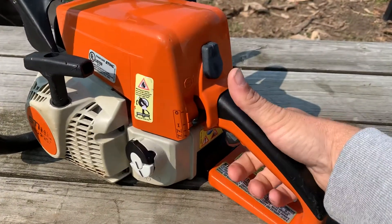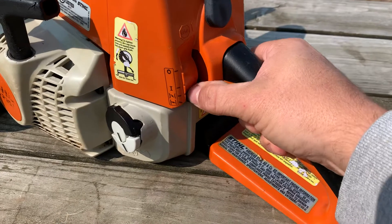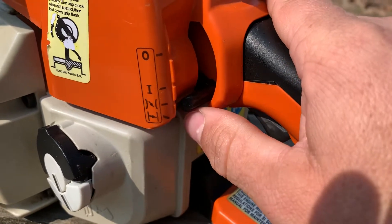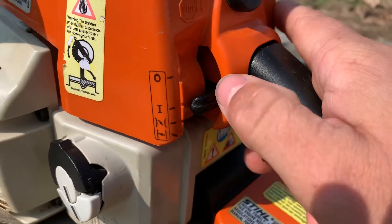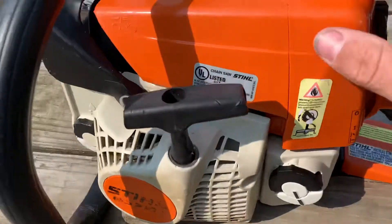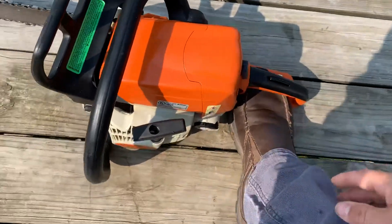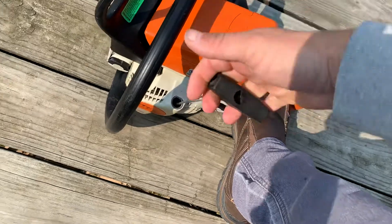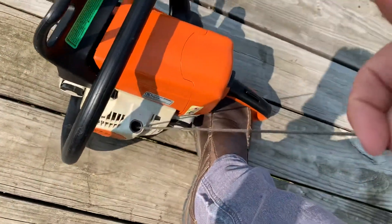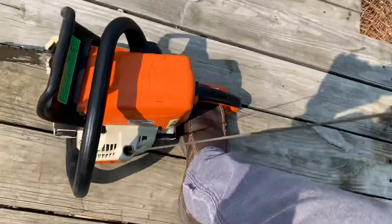So on these you've got your handle, which you push down on and then that frees it up to be able to do the trigger. If you don't, the trigger won't work at all — it's a safety feature. There's choke, and then there's like a high idle or race setting, then just regular, and then off which grounds out the ignition. So we'll put it all the way down on choke. You put your foot down here and you pull — see how it's not really loading up right away. See how it loads up that spring and then that spring releases. You can pull it and it loads up. That's really cool — I'm not applying a lot of pressure to it.